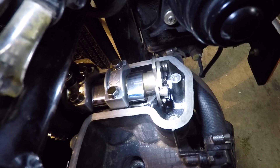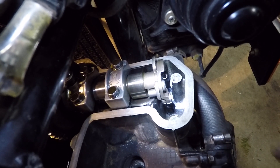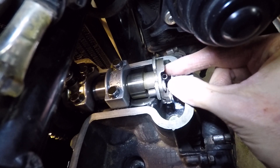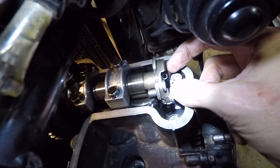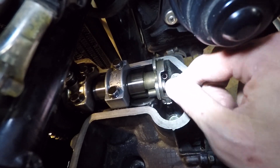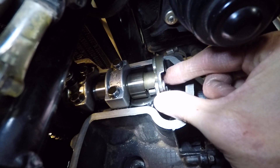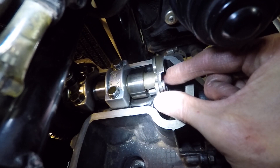Let's see if we can see it here. Did you see that? Anyway, that's how it works, and as it spins faster the weights come out and it sits back into its little home, no longer affecting the exhaust valve.